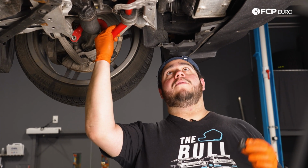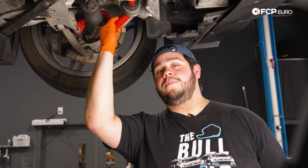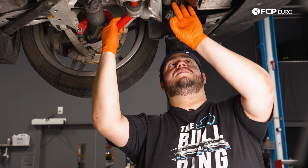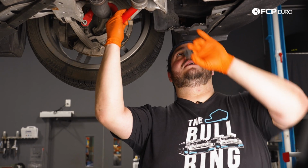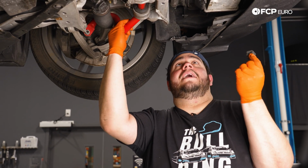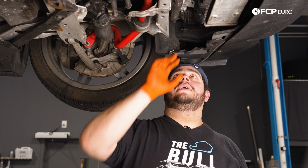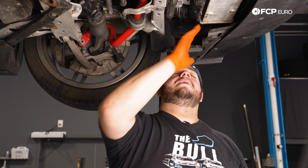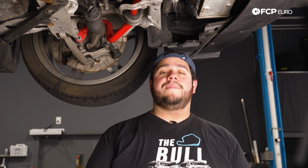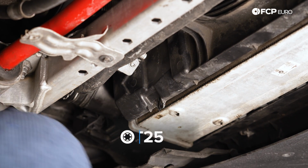Now, realistically, more than likely you have an upgraded intercooler and charge pipe system at this point, in which case you're not going to be using this rubber bushing. But for those of you that are still using the stock charge pipes and the stock intercooler, you may note that this fit is going to be a bit too tight. In our case, we had to pull the bushing. There's been times when we haven't had to do it at all. In this case today, we had to do that. So just be mindful before you sit down there for 3 hours trying to get this together and breaking your charge pipe or damaging your intercooler. Try popping out the bushing if you're fighting this bottom connection and go from there. Now with that, T25, let's hold this cooler onto our fan shroud and the skid plate can go back on.